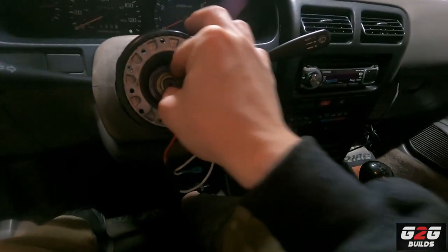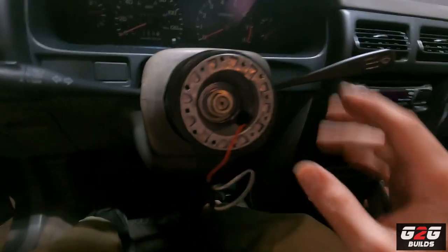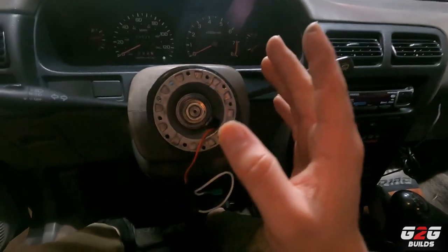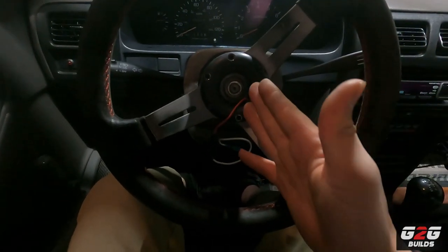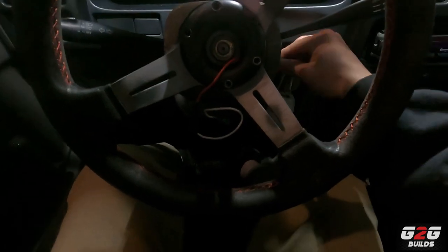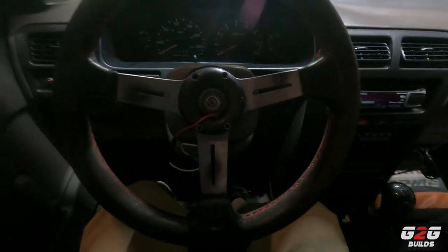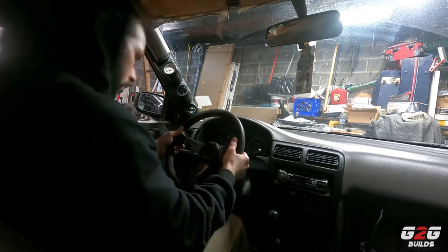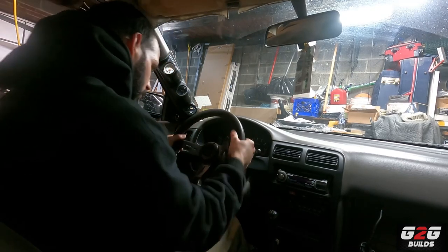This hub is very hard. It's almost out. What I'm going to do is put back the steering wheel with two bolts so I can actually get it straight and have leverage to pull this out. And boom — just like that the old steering wheel is on, but again when I was moving it it got locked. I want to make sure my steering wheel is straight. Now that I got it straight I can hand-muscle it out. Seven hours later — man, finally! Successfully got the old steering wheel out.